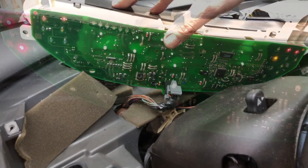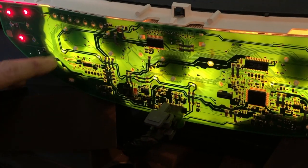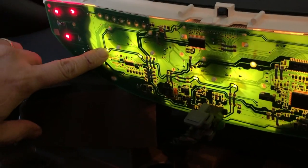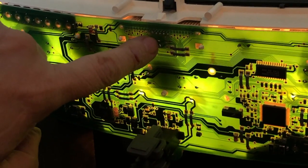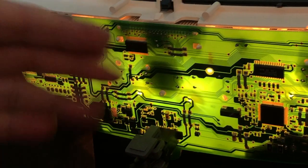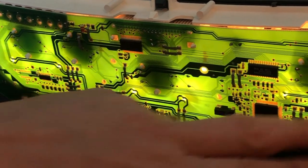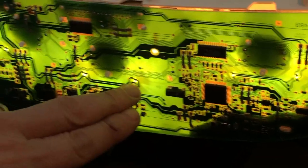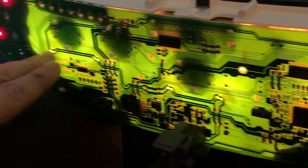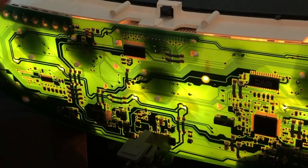Much better in the dark. We're going to turn the headlights on and check these bulbs with the illumination lit up. This one's lit, this one's lit — the only one that's out is this dark area behind the odometer. That means we don't have to do any other repairs. There are two bulbs for each gauge area. In total there are six gauge bulbs, and the seventh one lights the odometer. We know it's just the one bulb — let's get it out and change it.